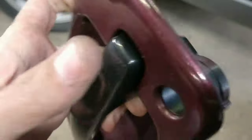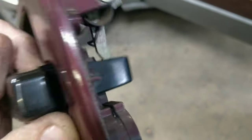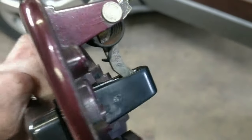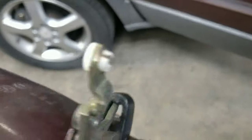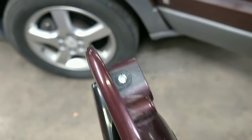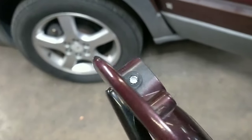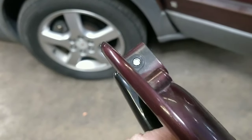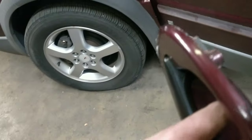I'm pushing up and it can't come out now. So this should last a long time like this. If anybody needs a new handle, just swap the handle over from the Dorman — you can reuse the Dorman pin. I just tapped it in with a hammer. It's snug, it ain't falling out, because the handle's like this, so it would have to come up to come out.